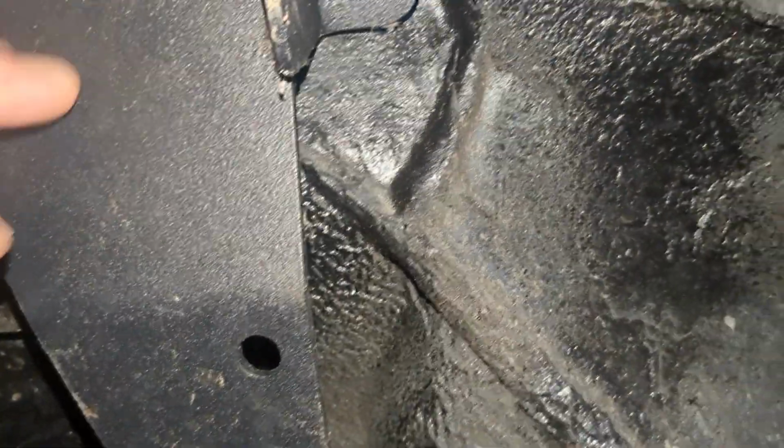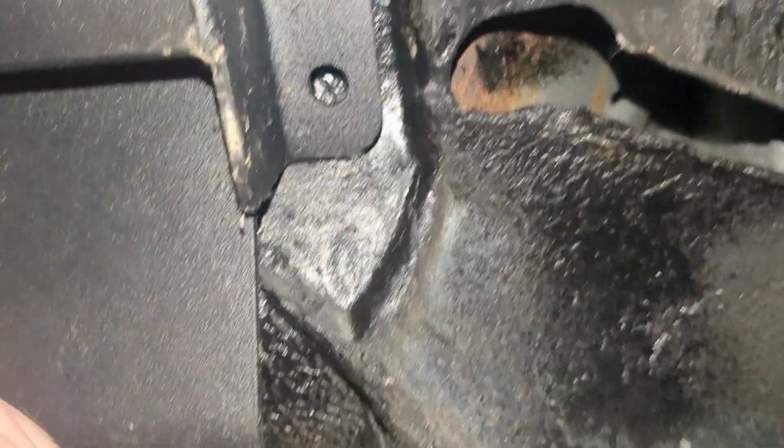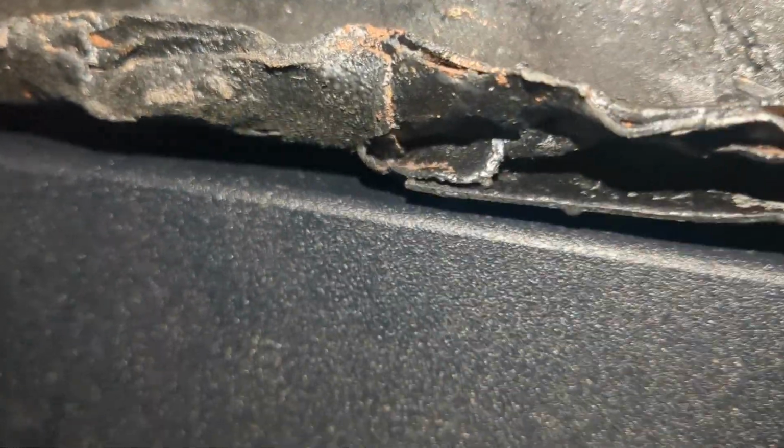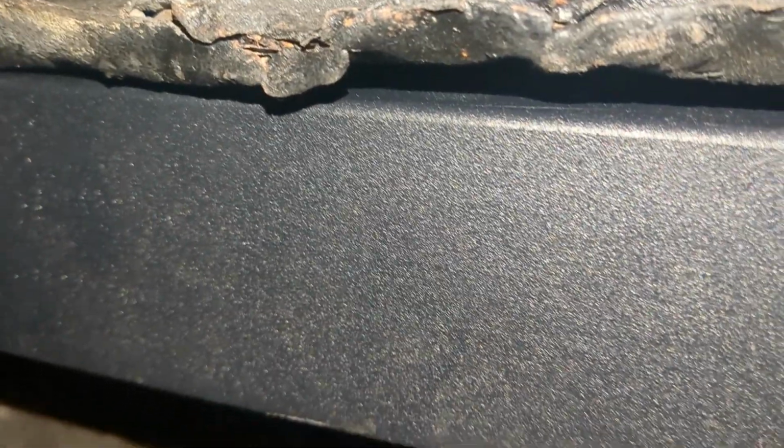All right, so I got it up into place. Here's my subframe connector. So it goes here. It's going to bolt there. And then it's kind of weird right here. I think it needs to get bent more, because it's not even touching the floor. Or again, somebody's tried to jack it from here, bottomed out here, or whatever. I might have to get a little nasty with the inside of this pinch weld here and just hammer that back, massage it a little bit.